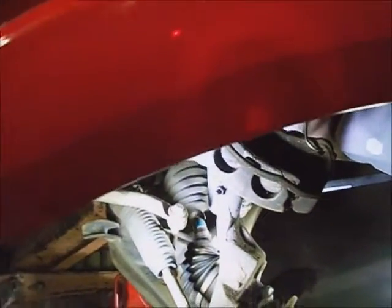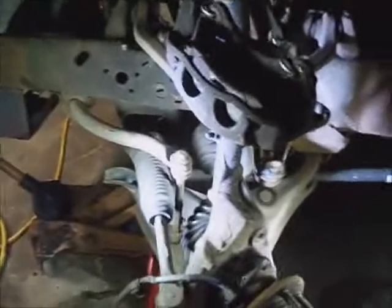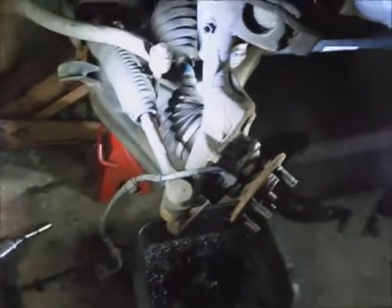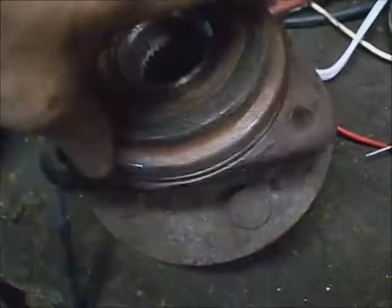Check if the other side's loose too. I turn the steering wheel to the left to get the front bolt out — turn your steering wheel real slow like you're in a parking lot with no power steering. If you turn it too fast it can blow the power steering pump cap off and spread fluid everywhere. I'm going to turn it real slow back to straight and start working on the wheel bearing. Now you can spin it by hand and hear how loud it is — oh yeah, that's the one.